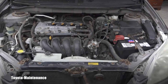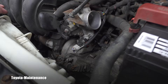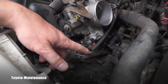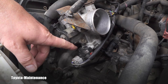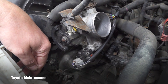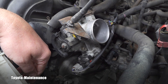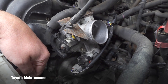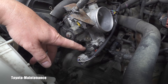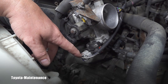You saw it in the previous video because it suffers with P0505, which is a problem with the idle air control valve. In the previous video I tried to show you around — we removed the valve and I tried to quickly clean it because the vehicle was sitting for approximately one year. I did a bunch of service and the last thing is that high idle: it idles basically at 1800 RPM and it won't go down. The throttle body is perfectly clean, everything's fine, but I believe this electromagnetic part is not responding.